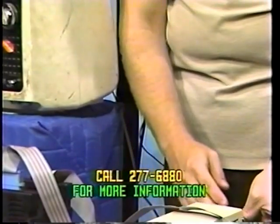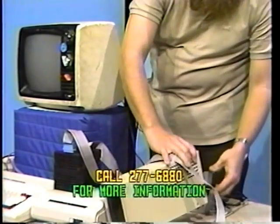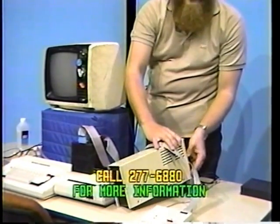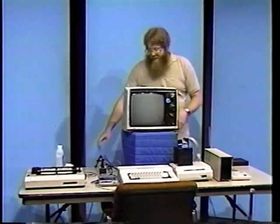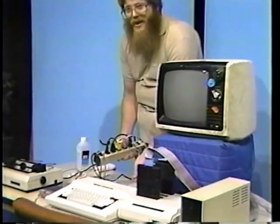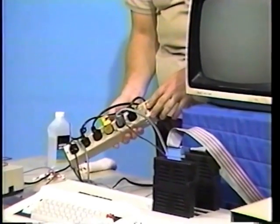Take the exact same cable and attach it with the equivalent of pin 1 to the back of the disk drive where the connector is available. Make sure at this point that the disk drive is also off. Now, plug all computer-related items into the multi-outlet strip. Make sure all the connections on all the cables are nice and tight. Then activate the power switch.